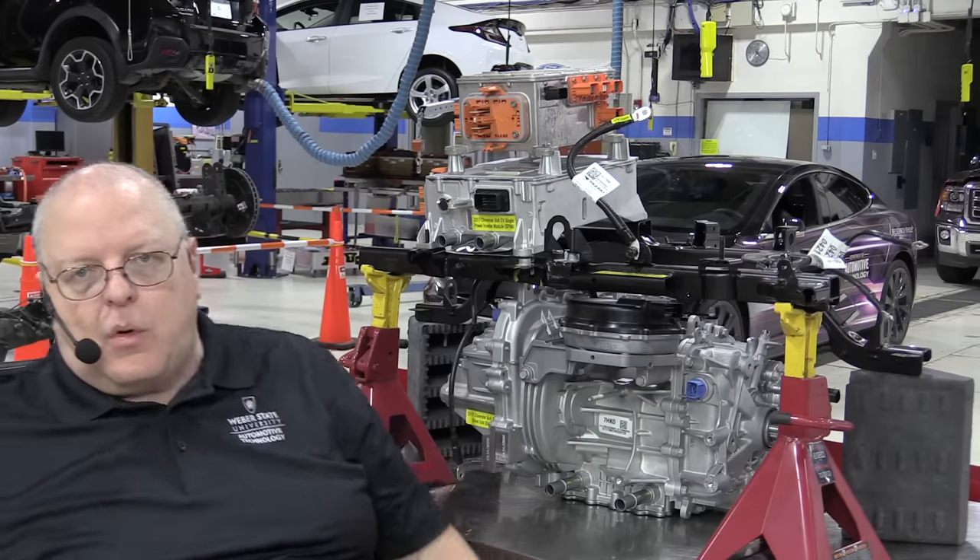These are the four major components that you can see under the hood of your Chevrolet Bolt when you open it: the High Power Distribution Module on top, the Single Power Inverter Module underneath that which drives the electric motor, the Accessory Power Module (DC to DC converter) below that, and the Onboard Charger Module at the bottom to take wall voltage when you plug in and change it to high voltage DC to charge the battery. We've got two other high voltage electrical components to bring in, and then we can start connecting the wires to show how they're all electrically connected together.